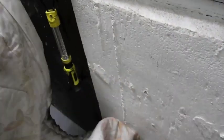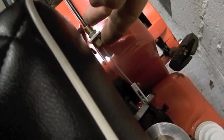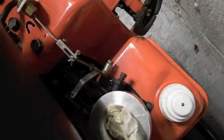The setup you have — you have that pivot arm on yours, which would be the same as the cat bike. This is what you would put on yours: you have this arm here, screw it into there, put the little bracket up here, and run your cable down. They actually sell this kit — it comes with the L bracket, a nice piece of aluminum, these two pieces that look like homemade plumbing fittings, this piece here, the arm, and a return spring. It comes with all that stuff for about nine bucks. It's a nice, simple setup that always seems to work, and if the cable snaps it goes back down to idle, which is a good thing especially if you have a powerful engine.